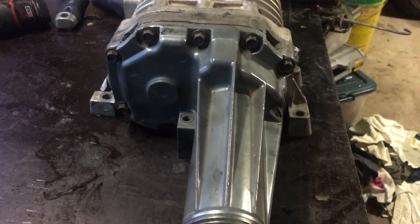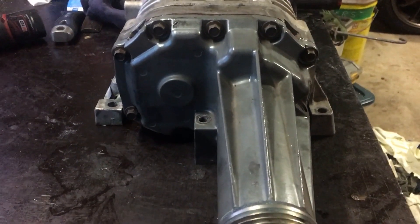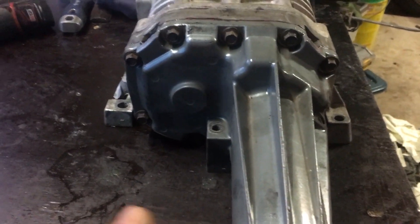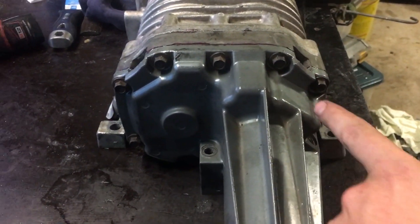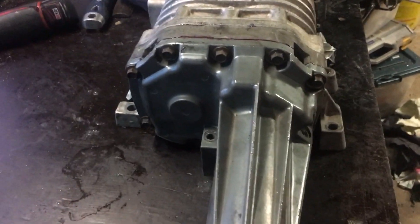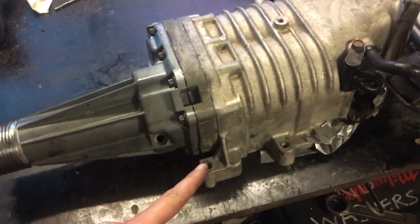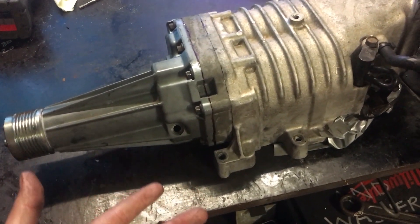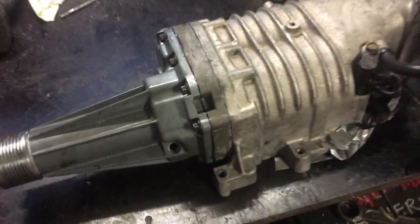You probably didn't see a lot of that, but that's all torqued up now. The zigzag pattern is a bit vague from the diagram, but it goes roughly one, two, three, four, five, six, seven, eight, nine - a bit of a funny Z pattern from the center out. So that's one ported M90. I don't have my oil here yet, but as I said in the beginning, it's 225 milliliters in that hole, then plug back in and you are good to go.